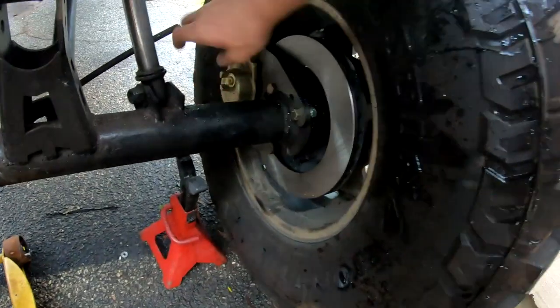I did have to tap the flange to accept the bolts. Don't know why. Not a big deal to me because I just have a tap. It takes an extra 2 minutes, but I did have to do that ahead of time. I learned that after taking the rotors and calipers and the whole hub assembly on and off like 15 times, and I also had to run spacers in between the flange and the caliper mounting bracket.